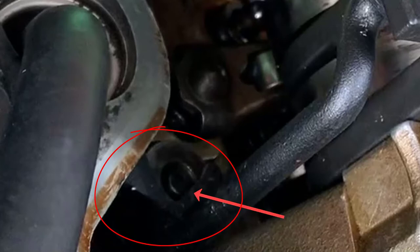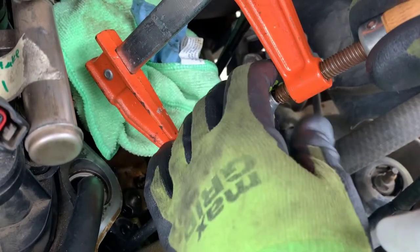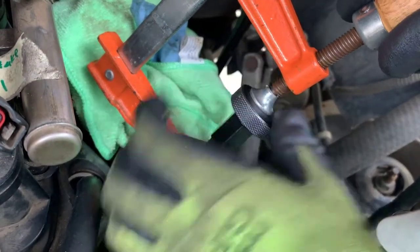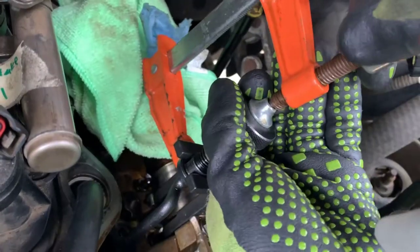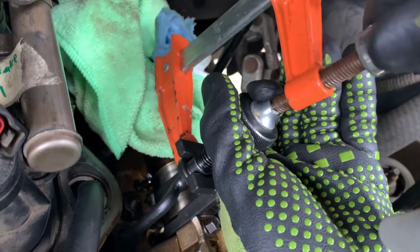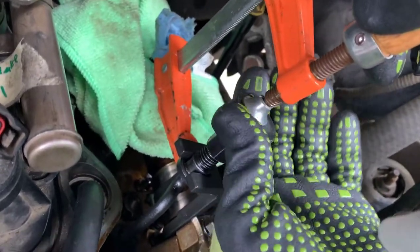Notice that the foot may be pushing on the top of the stem. Make sure that you leave the gap open so that you can get the keepers in there, and definitely don't push on the stem. So I keep adding pressure until it gets close enough where I can start to engage the threads. I push a little more and now I can start spinning the top and I'm on the threads.